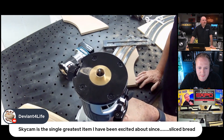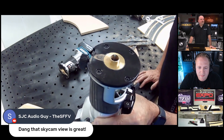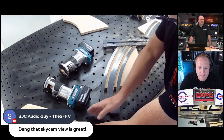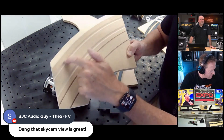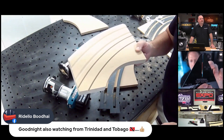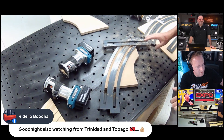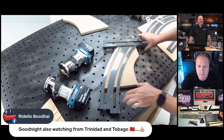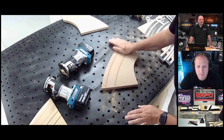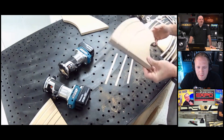One last thing before we pull this off — that's a 1/8-inch bit, and we decided on 1/8 inch based off that gap guide, which is why I showed it at the beginning. That 1/8 inch is perfect for vinyl and carpet so you can actually just tuck it and do one panel. If you want a carpet-to-vinyl blind seam right there, these are design elements — kind of a debossing. You peel this off... there's your tape, and there are your super clean lines. That would be next to impossible to do by hand.